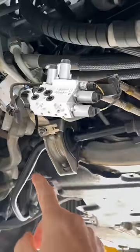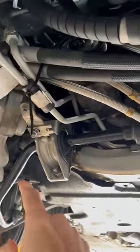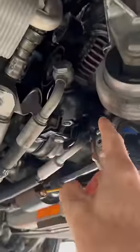What else is it compensating for? The motor is driven by hydraulic fluid, which comes from the valve body. The valve body is fed high hydraulic pressure from the pump. The pump is right here, and it also controls the power steering pressure. This pump builds a lot of pressure — 180 bar, which is the same as 2600 psi.